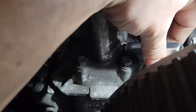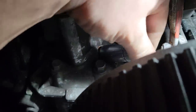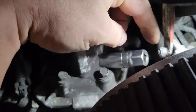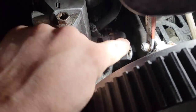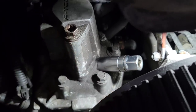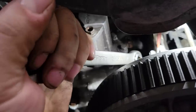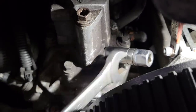That sucker is so rusty. The socket doesn't even want to go on it. She's on, but it's tight-accessed like a VIP club — the ratchet's not allowed in there. The handy thing about these spark plug sockets is you can put a three-quarter inch wrench on there. Come on, sucker — crack loose! At least it's not seized in there. Come on, one out of there. There we go.